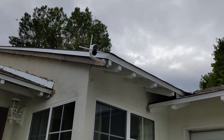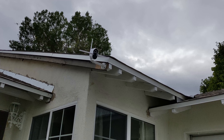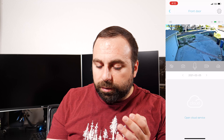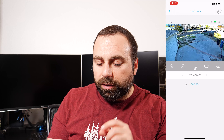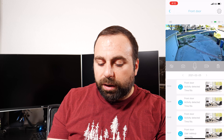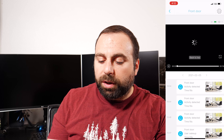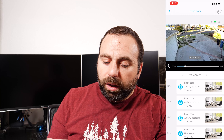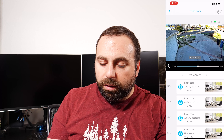Testing the front security system — this is an audible test. You can record video as well. For cloud storage versus regular storage: you can see activity detected at 16:04 — if I click on that, it loads from the micro SD card and pushes it to my phone. You can see it detected a car passing by and recorded that. Going back and clicking the camera again, it always defaults to SD viewing, but clicking it again goes back to HD — you'll see the 1080p label on the top right.